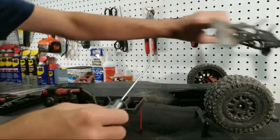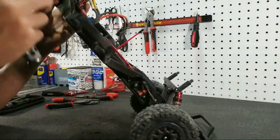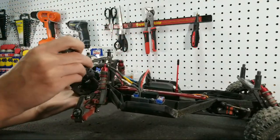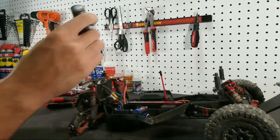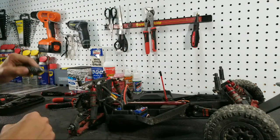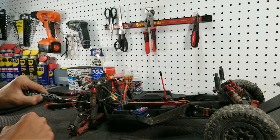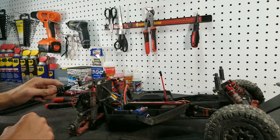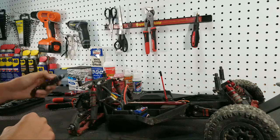Okay, rear bumper's off. I forgot I have the RPM transmission housing. So there's nuts on top, right up here, that I have to get to take the trans off. And to get to those, I have to take the top links off and the drive shaft off. But I can't do that without taking the shock tower off, and I can't do that without taking the body mount off. So pretty much I gotta take off the whole rear end.